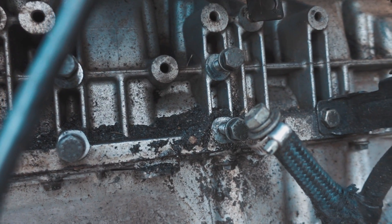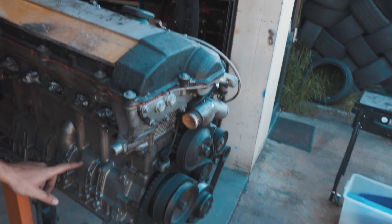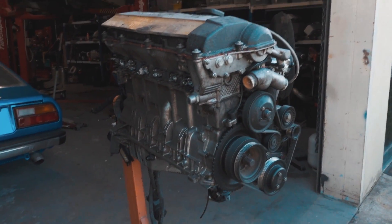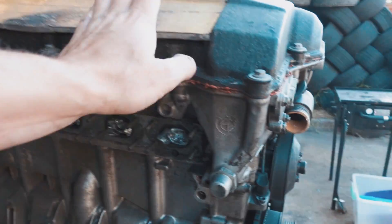There's just crap everywhere, but this motor still runs absolutely beautiful. It has ARP head studs and a cut ring head gasket. I helicoiled the block - it's the alloy block, I literally just hand drilled it and wound the helicoils in. This motor runs about 13 psi of boost and makes about 270 kilowatts, somewhere around the 350 horsepower mark. We absolutely bang this thing off the limiter all day long at events and it hasn't missed a beat.